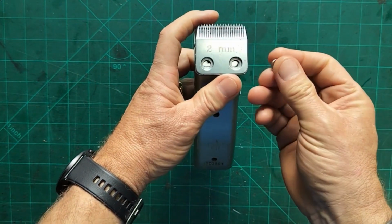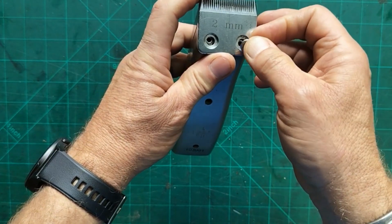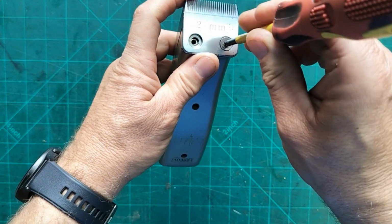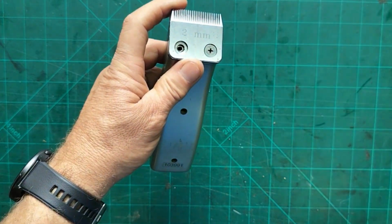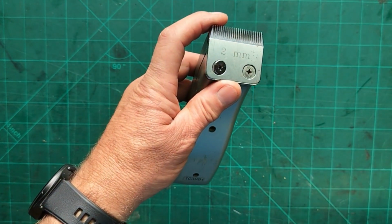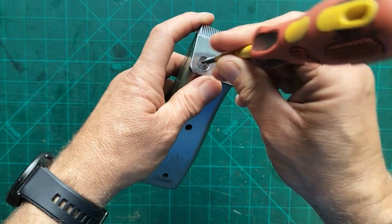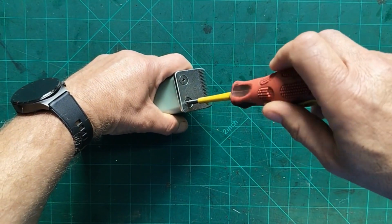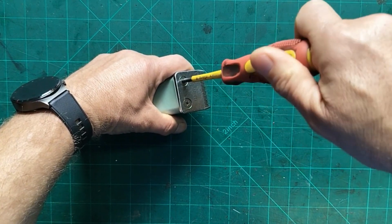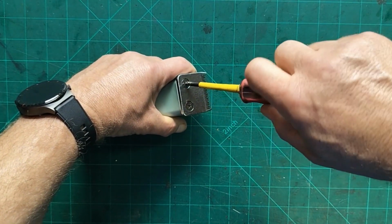We've got 2 screws. These screws are centering ones, so when you put them on, the way that's done, it will hold that blade wherever it wants to hold it, and you won't have much choice about it. So again, nice and gently as we go. I don't want to make these tight yet, because what will happen is if I tighten one up, it'll twist it out of shape before the other one's gone in. There we go, so one in there. One in there. See where one was tight, now it's gone loose. Now I can tighten them both up.